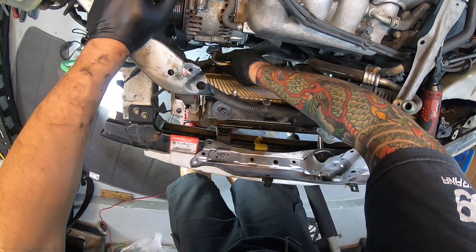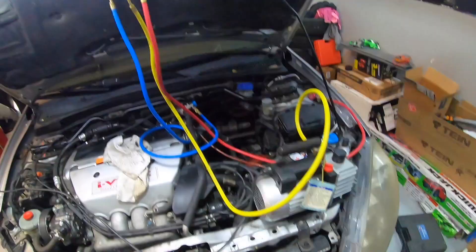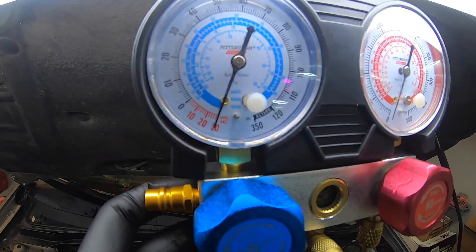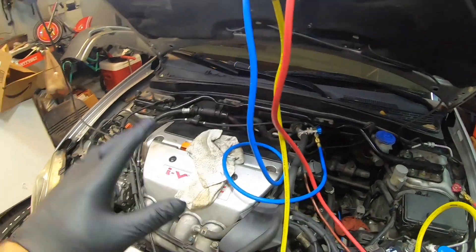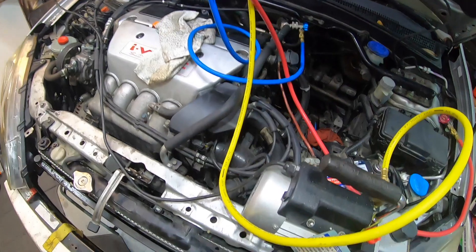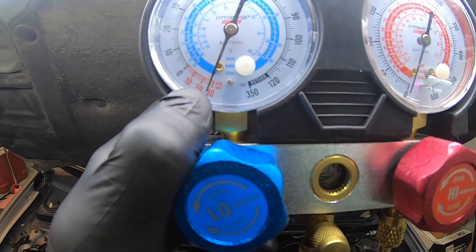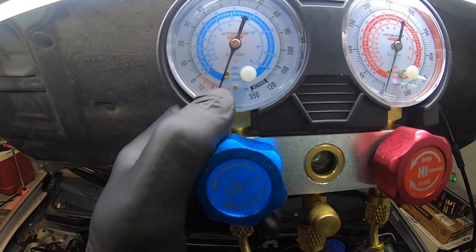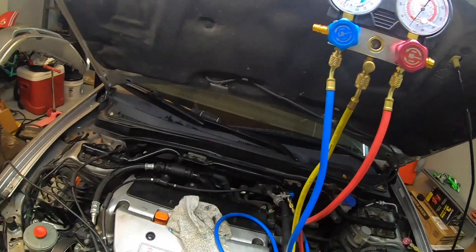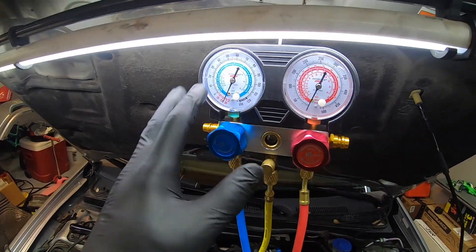Got oil on the seals. I got most of it all back together and the front bumper back on. I have a vacuum pump and a set of gauges — right now I'm pulling vacuum on it and checking for leaks. What the vacuum does is it removes any moisture from the system; the system starts drawing moisture as soon as you open it up. This is a way to check for leaks. I pulled vacuum on it for about 20 minutes — if this gauge starts to move below 15 or 20, that means there's a little leak and I need to go back and check my connections. But I'm pretty confident we're in good shape, and after that I'll go ahead and charge it up.